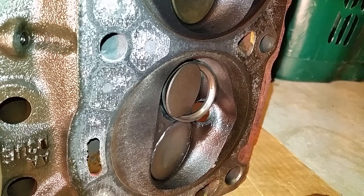I just pulled this cylinder head and look what I found. This is the reason why the push rod was ticking — the valve wasn't seating all the way, causing the rocker not to move fully up on the valve side, which causes it not to compress on the push rod as the lifter was going down. That's why it was ticking. That can't be good.